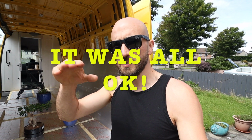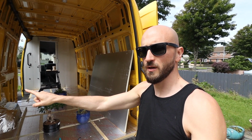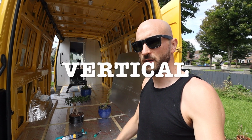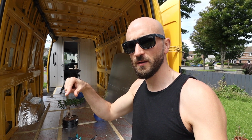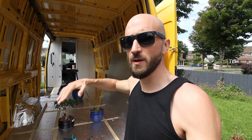And if I spot any area that hasn't been stuck down properly overnight, maybe it didn't connect with the Sikaflex, or because the floor of the van has a lot of ridges, so it's not completely flat. So what I've done is I've stuck the Sikaflex on top of the ridges and then put the battens on top of that, for the battens going across the van, and then it was easier for the battens running down the van because you just run the Sikaflex along